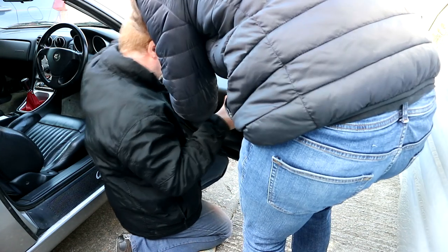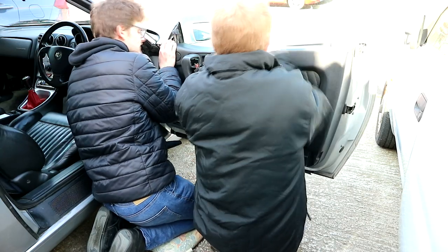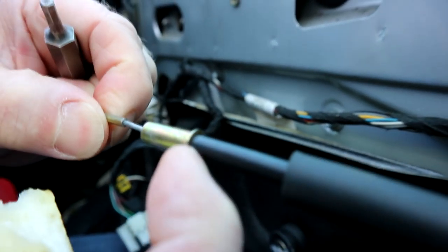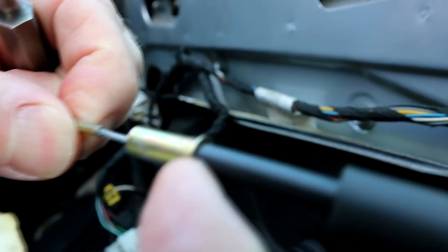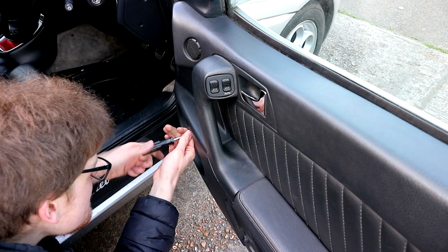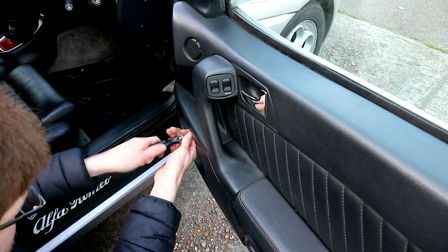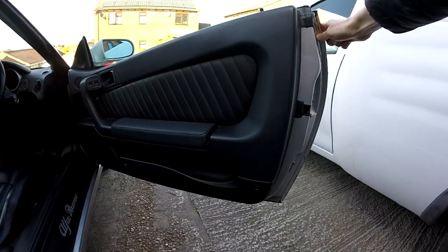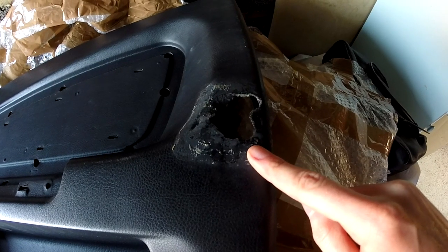The door lock pin is slid through the hole, and everything else is plugged in before we slot the card onto the door frame. This is a bit fiddly to line up correctly, but eventually we get it seated. A word to the wise: make sure the door release cable isn't completely taut when it's refitted to the handle, and it's got this little bit of extra slack in it. Otherwise the door won't close properly, and that means the car won't lock, and you'll have to take the whole door card off again to readjust it - not that I speak from experience. Screwing stuff into a door card needs to be done carefully because over-tightening it might crack the plastic. Thankfully cracks are avoided and eventually it's done. How much better does that look? It's not broken, not scratched, not dinged, there's no holes in it - the old one was holier than the Pope.